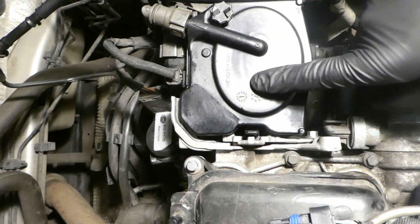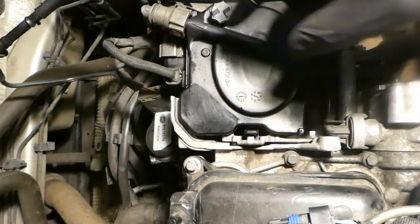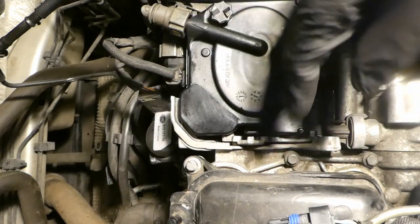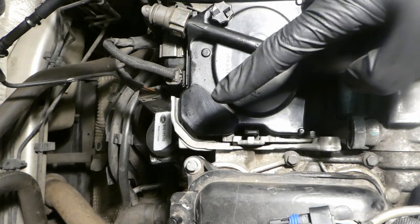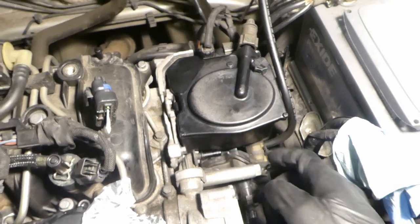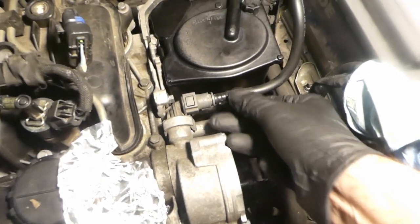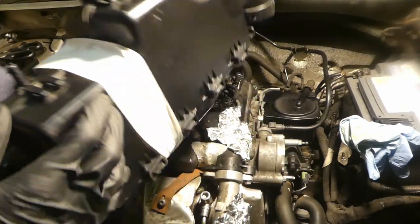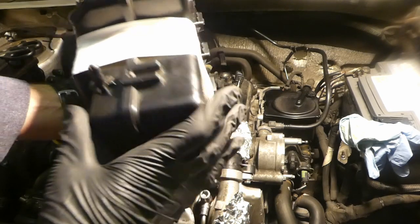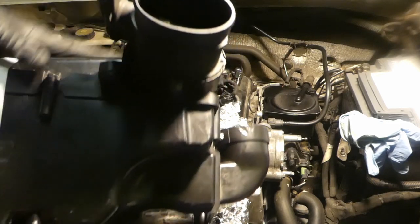The filter is replaced but it's empty with a lot of air in the system. There's a primer bulb that gets fuel around the system — you have to squeeze it quite a number of times. Squeeze until it gets hard and you can hear fluid coming through. Keep squeezing until it's really hard and you can no longer hear any air bubbles — this took several minutes. Squeeze about five more times just to make sure.